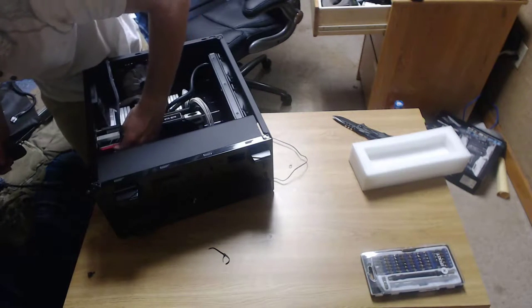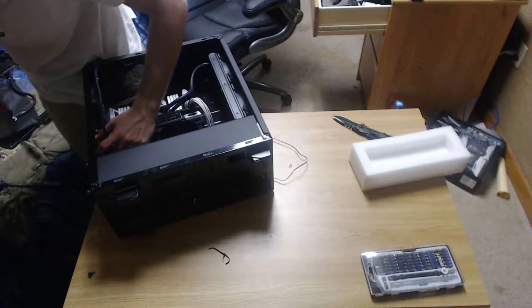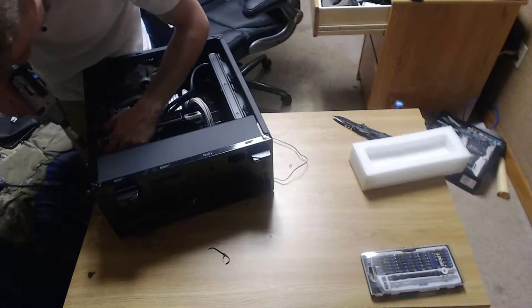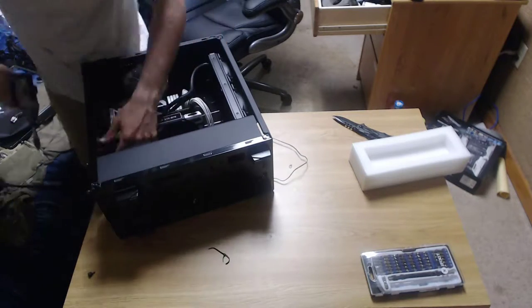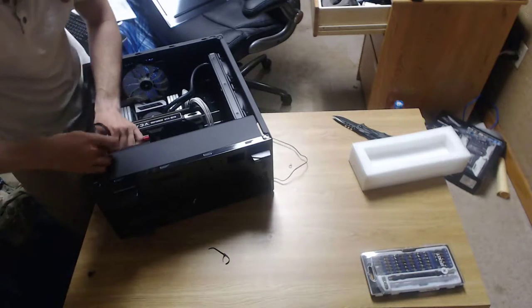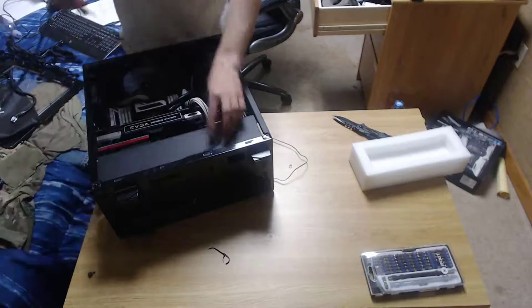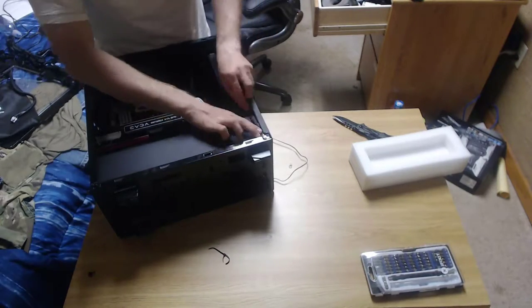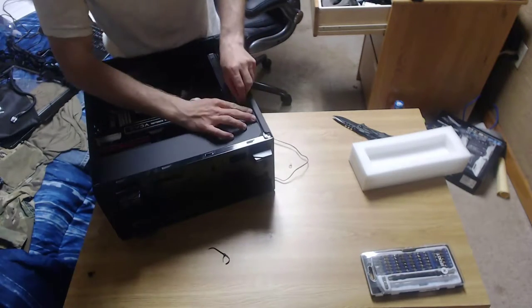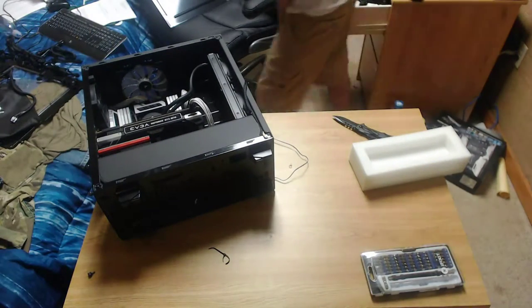It just sits on the back. It doesn't plug into the motherboard or anything. You control it with headers on the back. Basically, all you have to do for this particular LED strip is put it into the lane where you would normally have a PCI device and screw it in with a thumb nut screw. It has a Molex connector for the power for the LED strip, and it has three variants on the back, as I showed earlier in the video.